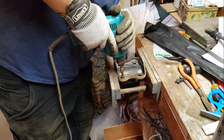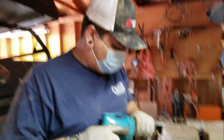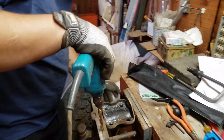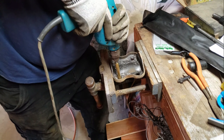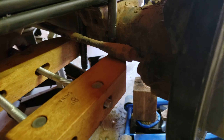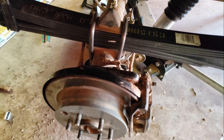Next, we needed to take the lower mounting plate for the U-bolts and drill the holes a little bit bigger, because the new longer U-bolts are slightly thicker — maybe about one thirty-second of an inch thicker than half inch. We also primed and painted the holes. Another issue was that the U-bolts didn't perfectly fit into the holes, so I used a clamp to compress the U-bolt slightly so the pins would actually go through.